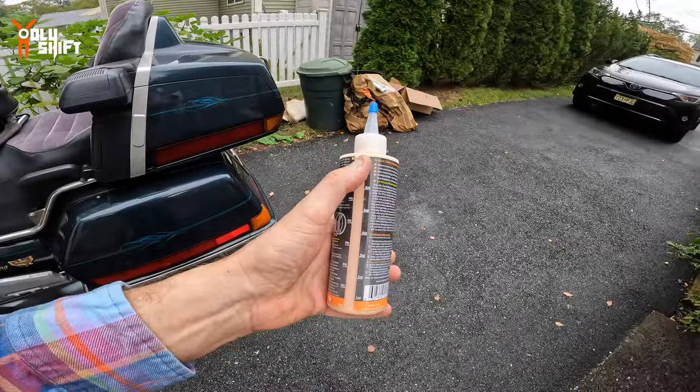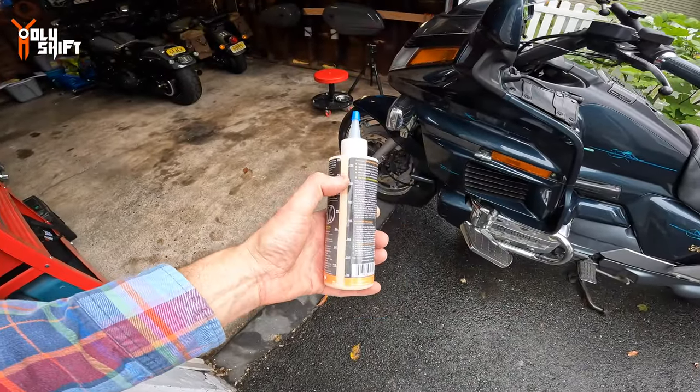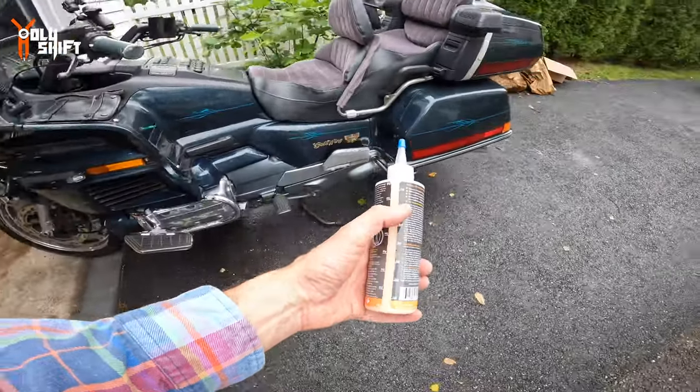That's why they call it Ride-On — it acts like a self-sealing tire. There are many brands: Slime, green stuff, yellow stuff, blue stuff — I just heard a lot of good reviews about this one. By no means is this sponsored; I bought it with my own money. They have a sizing table — you enter your tire size like 160/80-16 and it tells you how many fluid ounces you need. For my front tire I need 10 ounces — one full bottle plus two ounces — and for the back I need 12 ounces.